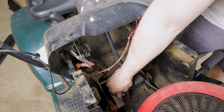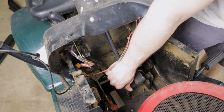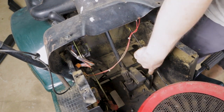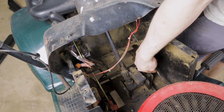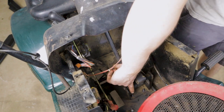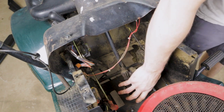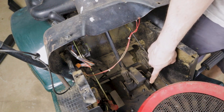There is a washer on there, so be sure to retain the washer. What that does is it unbolts it from this bracket, and everything is going to be loose. That connects to this bracket here. You could do this job if that bracket could come all the way over, but it can't. There are two self-threading bolts sticking up - actually four on this bracket. What we need to do is fully unbolt this bracket from the frame, and we'll do that from the underside.